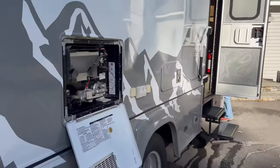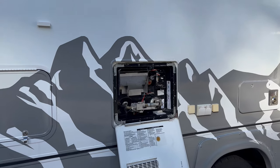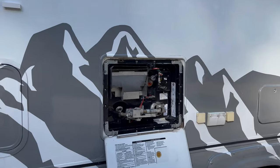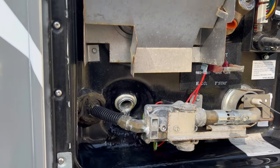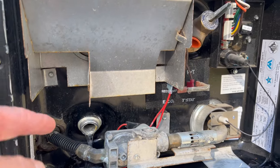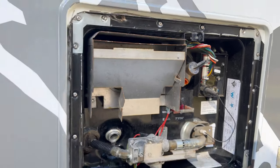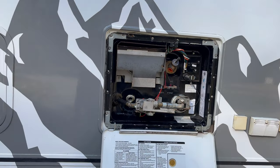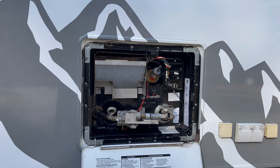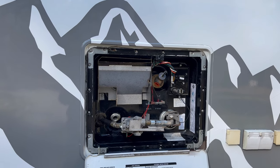So then we'll go ahead and bypass the heater, so we don't have to worry about putting antifreeze in the heater, which they don't recommend anyway. So basically we remove this plug here, and then once we do, we open this valve which vents it on the top, and instead of gurgling out slowly, it pours out quite readily. So that's it. And then actually what I'll probably do is move the truck so the tail is down, and that will drain that completely.